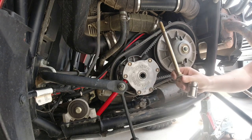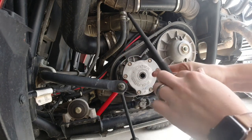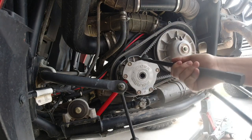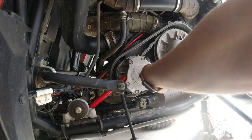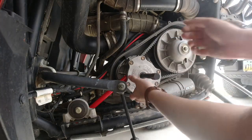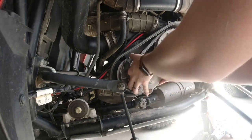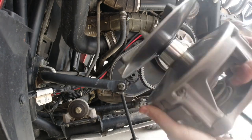We've got this out — make sure you don't lose these two washers on the end. This is the clutch puller tool I have; it's a Tusk brand. Basically you just thread this in by hand and once it's nice and snug, go ahead and tighten down on it, which will push against the crankshaft and pop this off. It may come off nice and smoothly, or we may end up with a nice loud pop. It did its job. Pull this out of here — pretty dirty, we'll get that cleaned up. There it is: primary clutch.